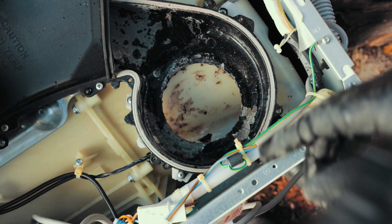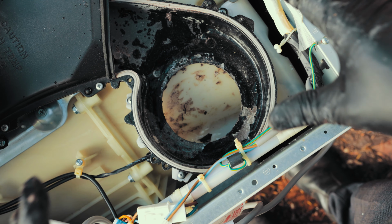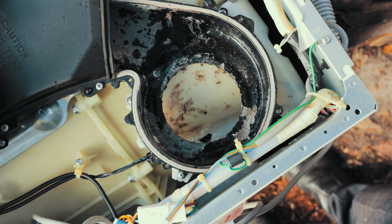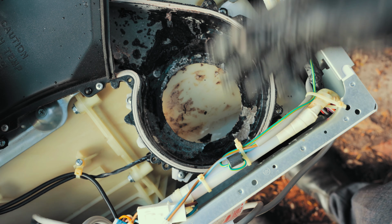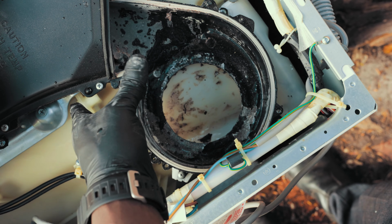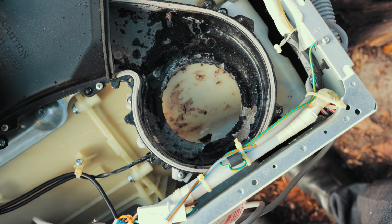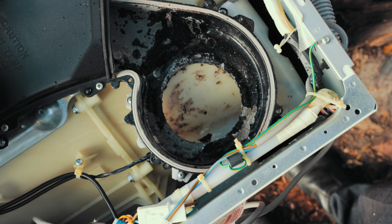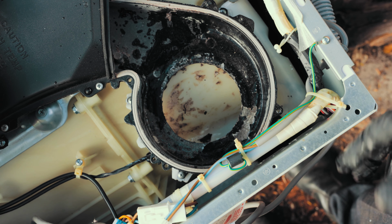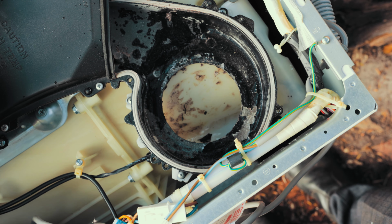I'll post a link below or somewhere in the caption of this video to how you can change the pump on your washer dryer combo, because your pump is working a lot during the dry cycle, because the washing machine is actually pumping water into the drum so that it can cool this drum. If it doesn't cool this drum, it's going to crack or it's going to melt. So that's why the pumps in washer dryers usually fail, because they're overworking. They work through the wash cycle, they work even more during the dry cycle. So you can imagine that happening over a year or 2 years, they tend to break down. No fault of their own, it's just how it is.